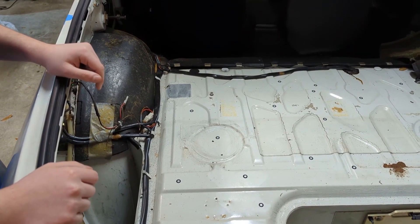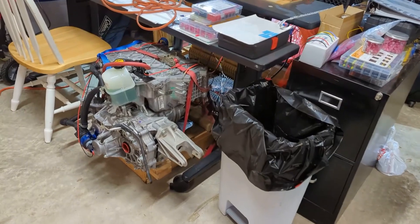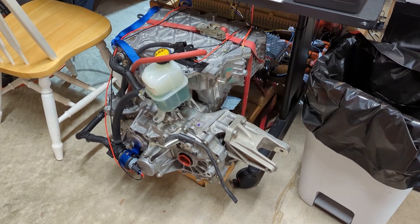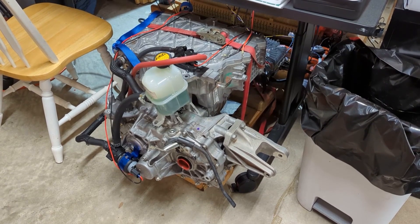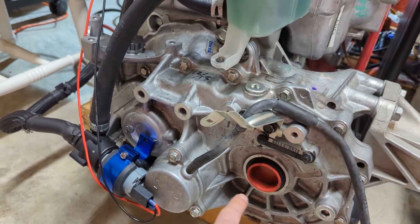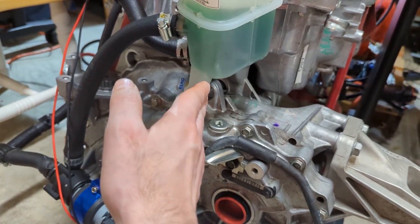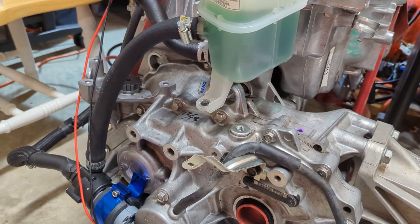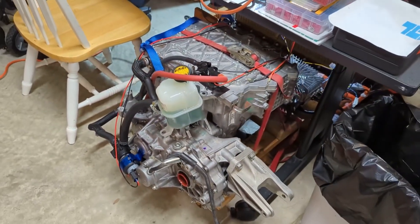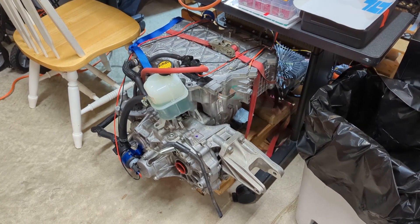We looked around underneath there. The last thing we want to 3D scan — and we might do it tomorrow — is underneath the car, because we need to figure out how the motor and differential might fit under there. Looking at the shape and the distance from here to the motor shaft, there's a big cross member that's going to be a problem. We can take the inverter off so it won't be as tall, but I think I need to find some 3D models of the Nissan Leaf motor, gearbox, and inverter.